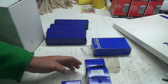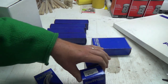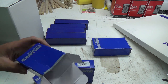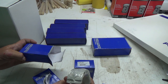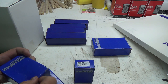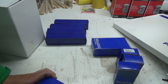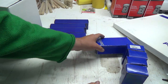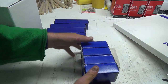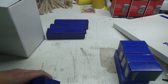So these would be all rod bearings. I imagine they're all the same — these ones are sealed, this one's not. Maybe they just check to make sure they're actually in there. STD is standard, so hopefully this engine is still all standard — on that I don't know. I guess we'll find that out when we get into it. So those were the bearings. I had to order those separately — they didn't come in this kit. I just thought, while I'm in there, I might as well do them anyways.